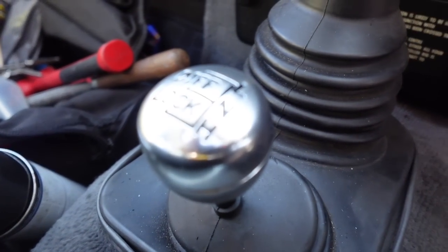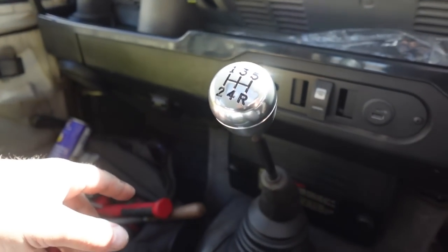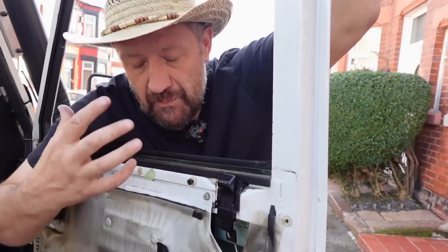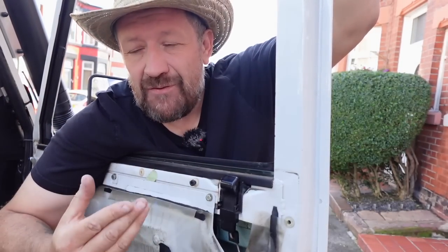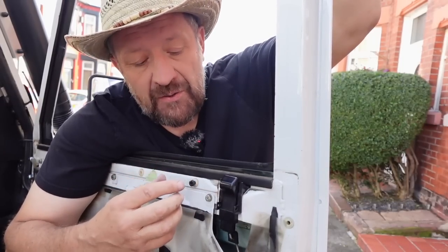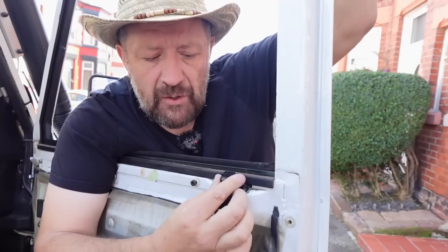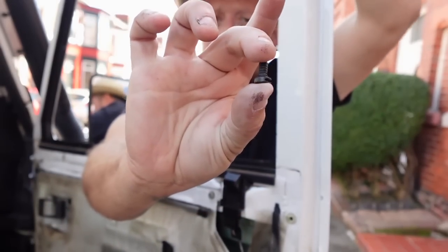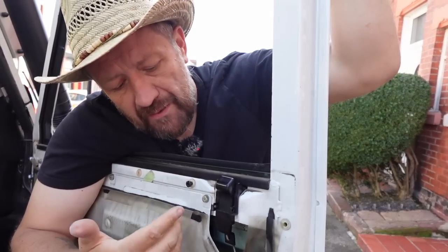There's that one and this one looks even better. Really pleased — a really cheap and easy solution. The last job today is to refit the door card trim using some new fixings from a kit supplied by LR Parts. Rather than buying individual parts, they do a kit which saves quite a bit of money. It replaces the push button, the channel guide that mounts onto the door, and the surround that goes on the door card itself. You also get all the new fixings you'll need — most of these do break when you take the door card off.